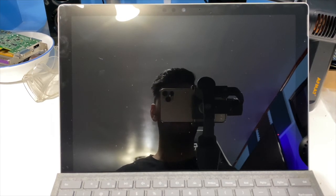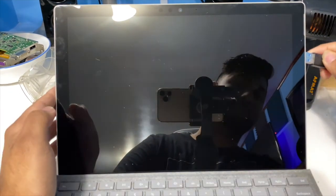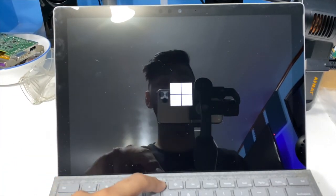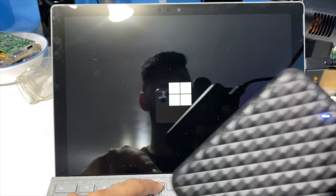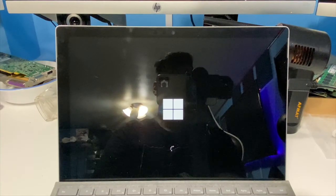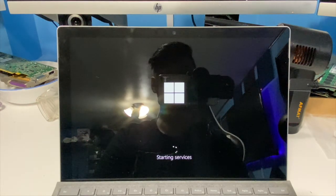So after you've made your Windows To Go drive — I'm using the Kingston right here — we're going to plug it into the Surface and boot it up. Hold the volume down button. This drive has an indicator light so we'll see what it's doing. Be patient — sometimes it takes a while to boot into this, especially the first time. About five to six minutes later it finally started showing the dots. The steps are: hold the volume button down, then click the power button, then watch for activity on your flash drive.